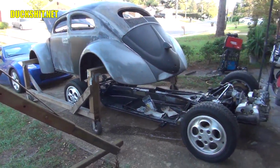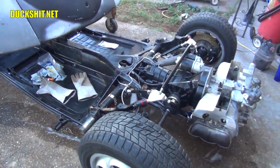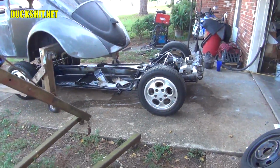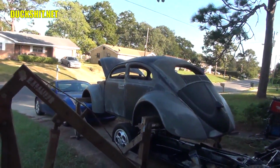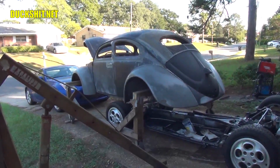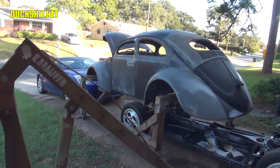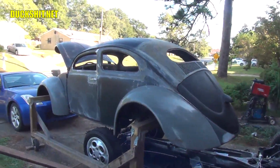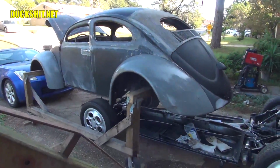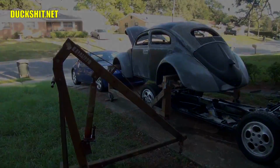The only big gotcha is most of the way ahead stuff is in the chassis, particularly in the rear, you know, with the engine and the transmission and all the rear suspension. And yeah, that was a ton of work. And of course, the Porsche brakes, both front and rear, are on here as well. As far as the body is concerned, I really did a lot of micro welding, very, very small areas where there was seams and things that were open or unfinished that I just didn't get around to, that finally are done now. And I still need to do some more work on that passenger door, and there's a lot more to do on the inside of both doors, as well as the rust area around the windows. But enough babble. It's time that we take this cherry picker and get that body loaded.